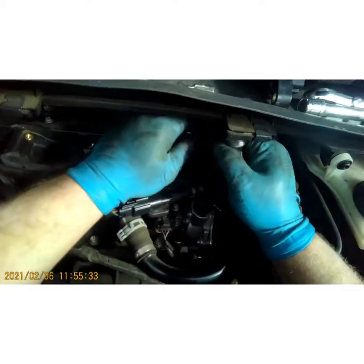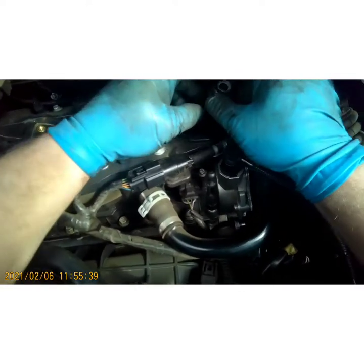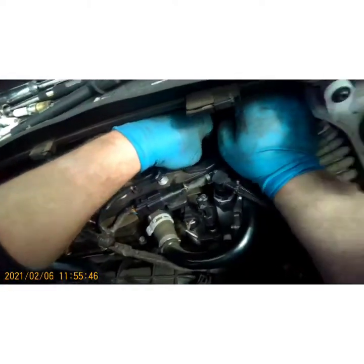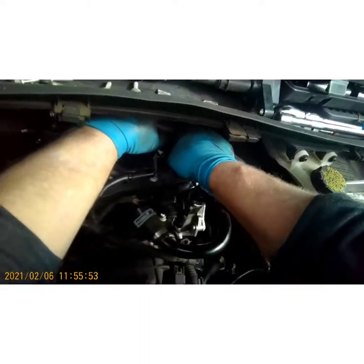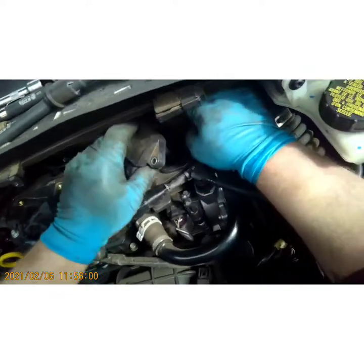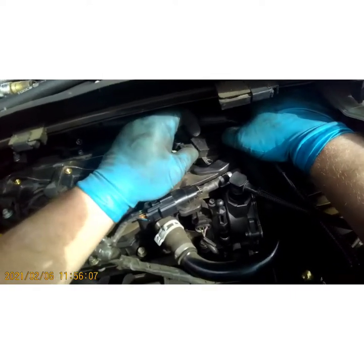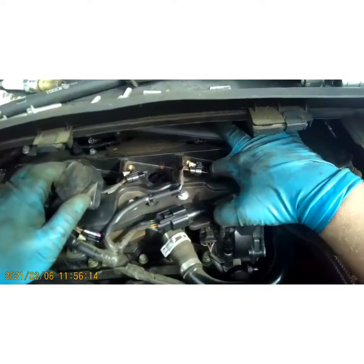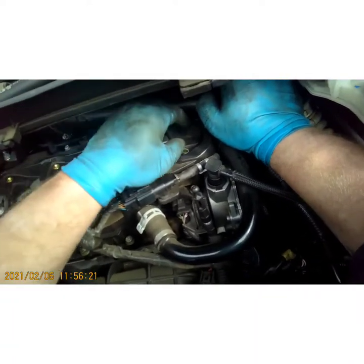It's a little tighter right here. Let's pull your extension off first. Pull it up enough to get that other extension off, depending on what combination you're using. Okay, I'm on it. Come on, baby. All right. That one is a little deeper down in there, so I'm gonna grab my coil and push it down in there. Come on, baby. Don't want to damage that boot.